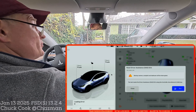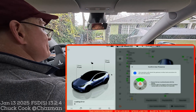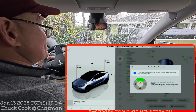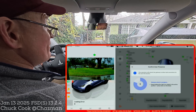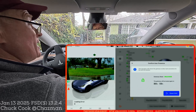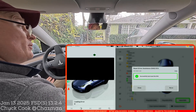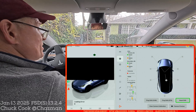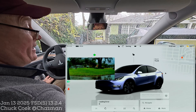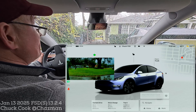When you reset the DAS, you get the option to run. Here in the Model Y, the unlock prompt notes the operation unlocks for 90 minutes, to ensure the key is authenticated with the vehicle, and to hold the right turn signal in the active position and the brake. Of course the right turn signal is a stalk in my Model Y. Hold the brake — and the countdown timer runs for eight seconds. Then the gateway is unlocked for 90 minutes. Press the reset DAS button and it successfully hard resets the DAS. Now back out of the service menu — close that — and use the long-press exit button. When you exit the service menu, it's not a tap, you have to long press to exit. And then we're back out and the driver assistance system has been reset.